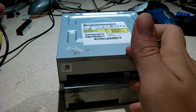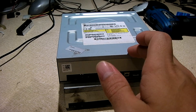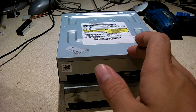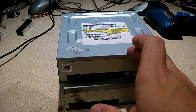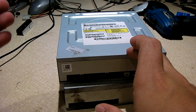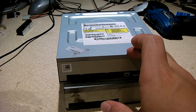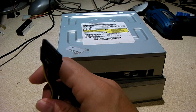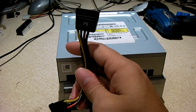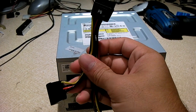Mind you, these were from two different computers, and I've actually seen this happen to several more at the organization they came from. The thing is, these particular machines decided not to use a standard ATX form factor where your power supply sends out all your different voltages. Instead, the power supply in these machines sends out about 300 watts worth of 12-volt DC to the motherboard. The motherboard only gets 12-volt DC, and it uses DC-to-DC conversion to convert the 12 volts to 5 volts and 3.3 volts respectively, along with a control rail.